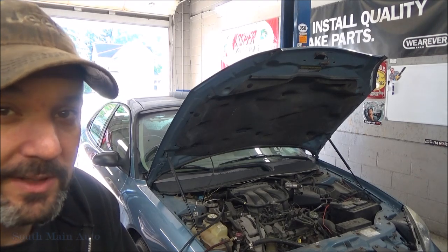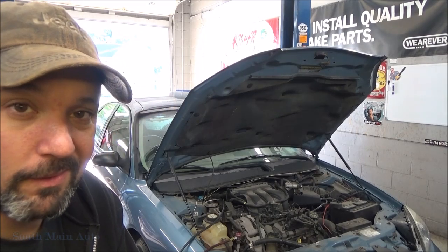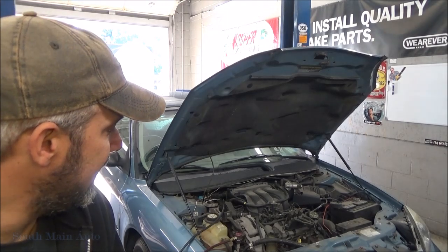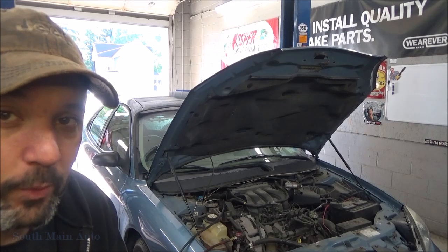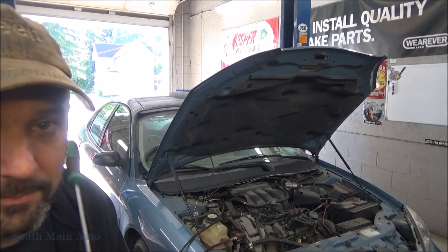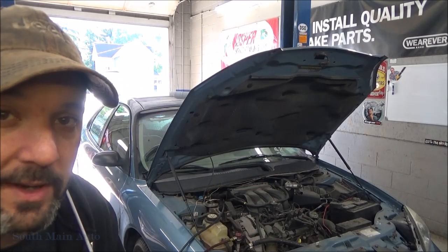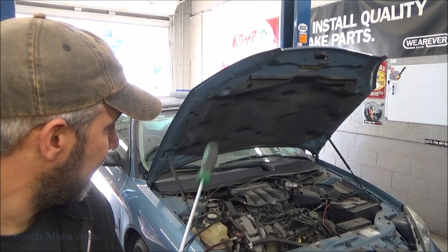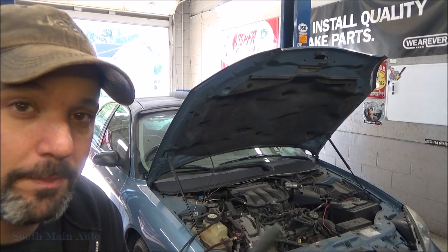The clutch is pretty wobbly on there, like the clutch face isn't parallel with the hub. I don't know if it's broke a rivet or what the deal is, but it's pretty weak. The magnet feels kind of weak. The more I've clicked it on, the better it seems to be working, but I think this is just your classic clutch problem. Compressor seems to work. I don't think we need to get too excited and go tossing a compressor at it, but I'll see if I can get us a new clutch hub, bearing, that kind of stuff. See what it takes to fix this old beast.